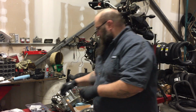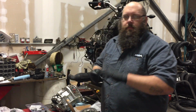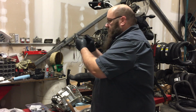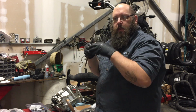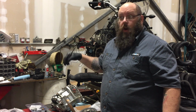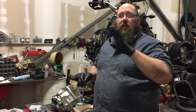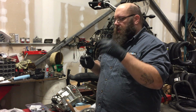So you squeeze on the clutch. We're replacing the master cylinder for reasons. So the slave cylinder pushes this in and separates these three pieces just a little bit, moves the friction disc so that you can then shift gears. It's just like a car, correct? This is an automotive style dry clutch. That's why you have transmission fluid and engine fluid.